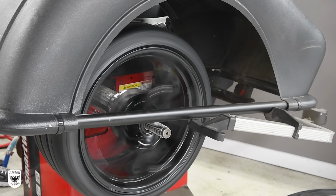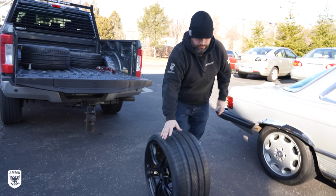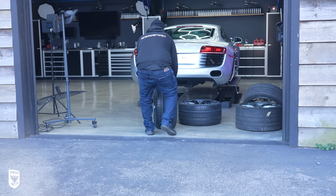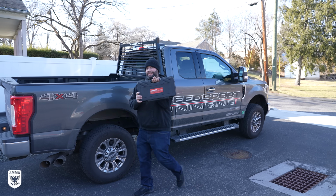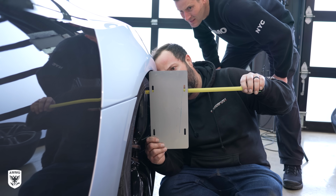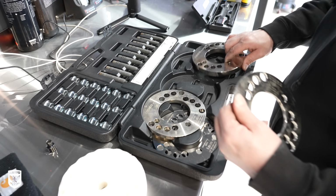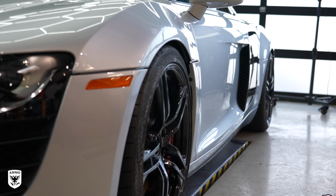With the Vorti Pluses now road force balanced, Mark came over to help me decide what size spacer would actually fit in the fenders with the JRZs, lowering the overall ride height. After a bit of eyeballing and measuring, we tested a few different sizes with his kit and landed on 10mm up front and 15s in the rear for a meaty stance and ordered them for overnight delivery.